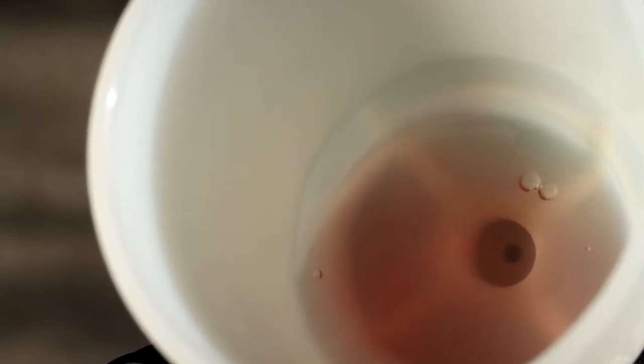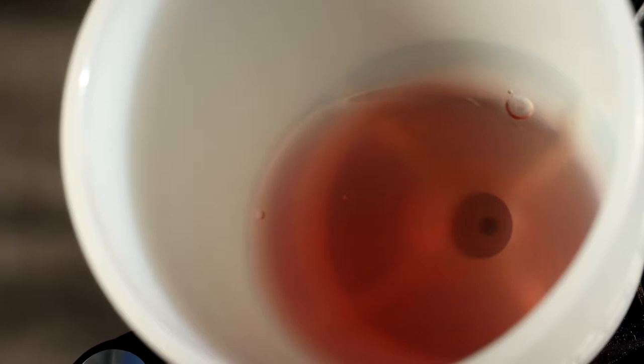At this point, you can push the syringe, moving the oil from the caliper to the lever. Bubbles should come out first, and in my case, they were followed by a very transparent and apparently not red oil, then with some black stripes.